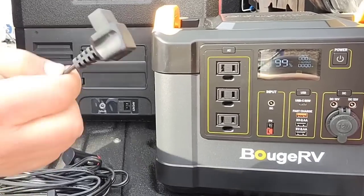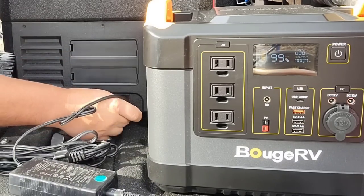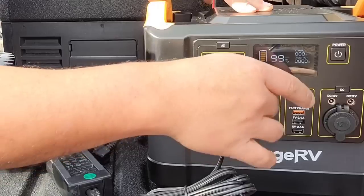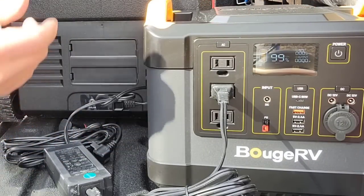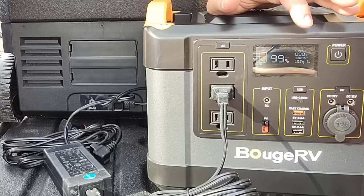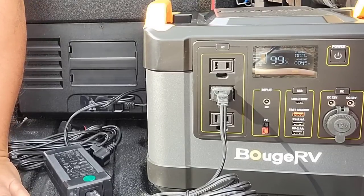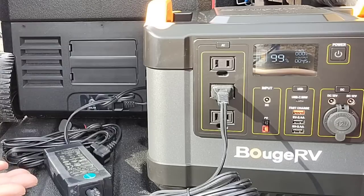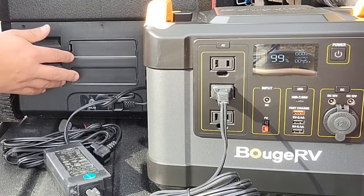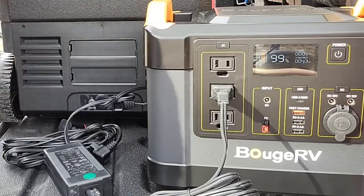Let's start off with AC. We're going to go ahead and plug it into the unit — this is a dummy-proof plug that only goes in one way, and I like that about equipment. We'll see at what wattage it starts using. First we have to turn it on — that would help. Alright, I just turned it on and we can see our wattage down here. Right now it's at 51, 43 — it's bouncing around a little bit. We'll let it stabilize for maybe 30 seconds. I'm not sure if you can hear the compressor — it's on right now with a little burring noise, but it's not really loud. I think the birds chirping out here probably make more noise than this compressor. We can see here that it's stabilized at about 45 watts.